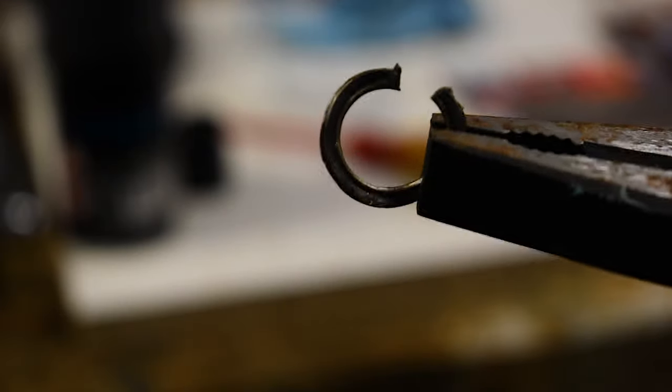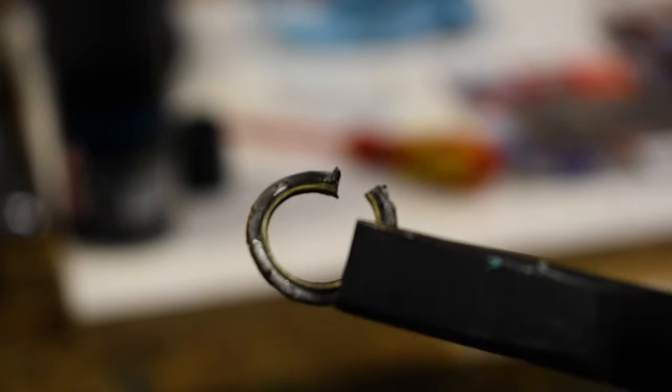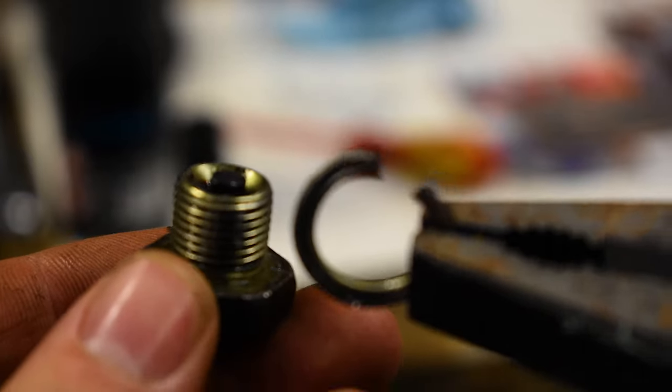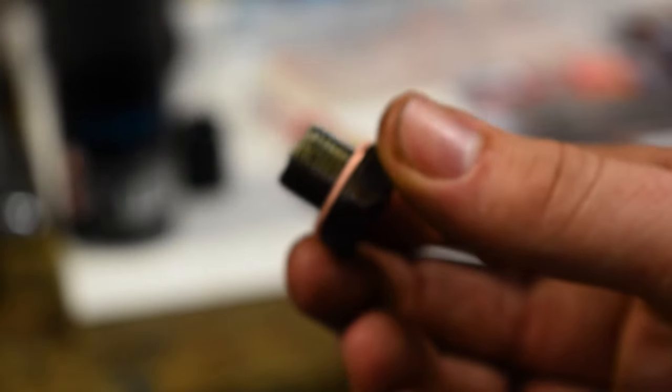I will be victorious — and as promised, it's off. What I actually had to do was get a screwdriver and hammer it through the washer because I knew the washer would be soft. The only thing you want to be careful of is not damaging the threads on the bolt if you want to use the bolt again, because the hammer will do the same damage to the threads as it will to the washer. But there you go — it's off. New copper washer going on, nice and shiny.